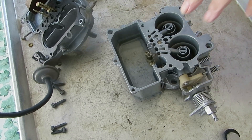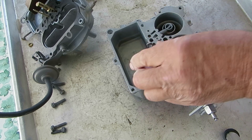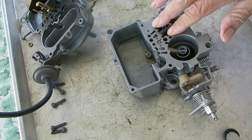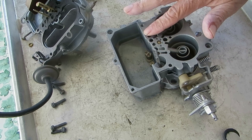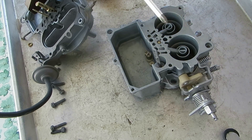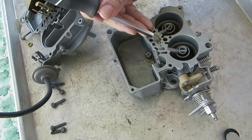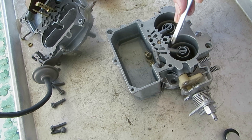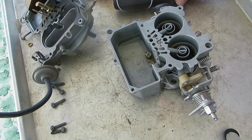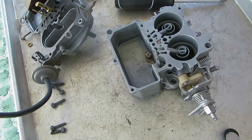I was hoping I could figure out a way to make this discharge work with the top off, but I can't — it'll take some really flat stock for it. So I'm going to explain it to you. If you have some flat steel stock, you can put it over here. You need something that will allow this check weight to move up a little bit and yet not too far. When you press down on it, it's going to force that check weight up a little bit and allow fuel through. It's going to go right through here — you see these two really small holes, one on each side — and then they come out right here. That's where you want to see the squirt come out: those two holes, that's your accelerator pump squirt. These holes are just so small — about the smallest you'll see on a carburetor — so you want to be sure those are really clear. You might find a stick pin that fits those holes.